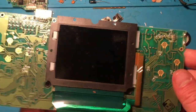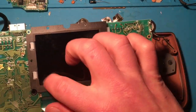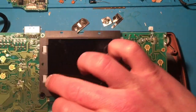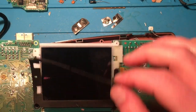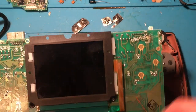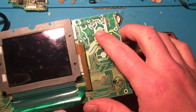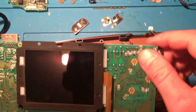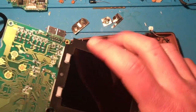This is our display — you'll notice it's got some gunk on here; I want to clean that and see if it'll come up. We're going to give this display a bit of a cleanup, but be careful with this ribbon connector — that's what makes the display work. Checking these button pads for any oxidization — they don't look too bad, so they should be just fine.